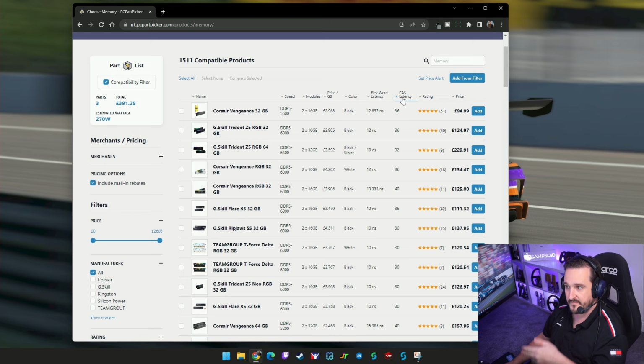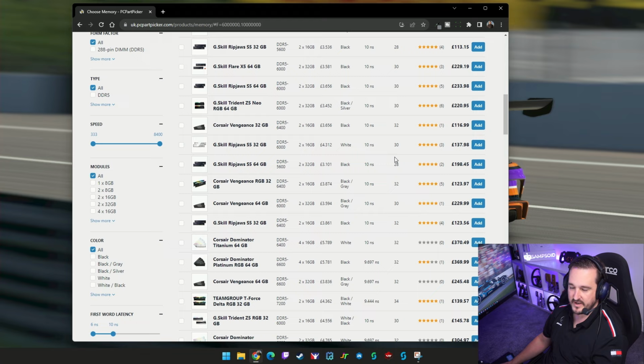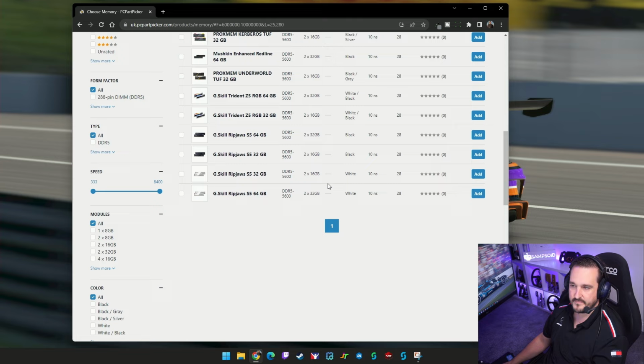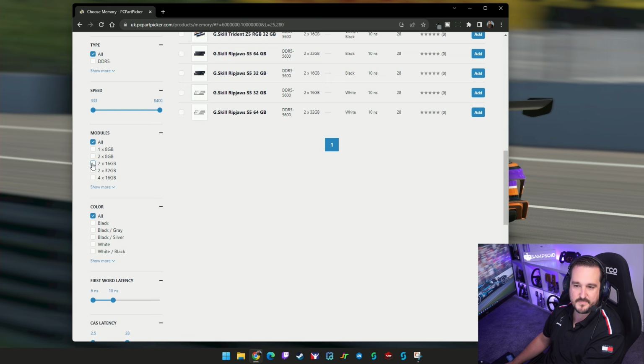So let's go and limit those first. First up, the first word latency. We can see there's a lot of numbers here. Perfect. And on the CAS latency, let's get rid of all these 30s. We want sub 30. Let's do 28. Okay, that still leaves us with 21 products. And on the size, i.e. the memory size, for this build, let's go with two sticks of 16 gig.